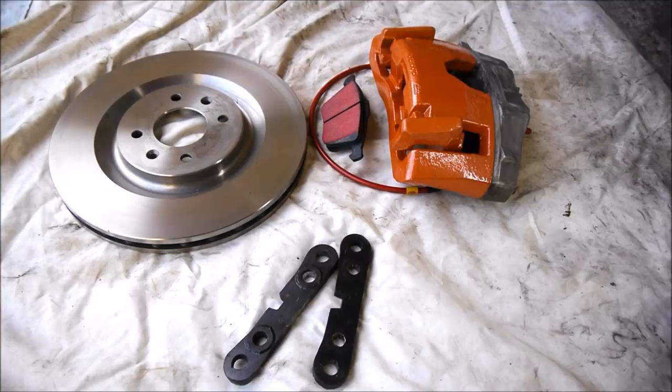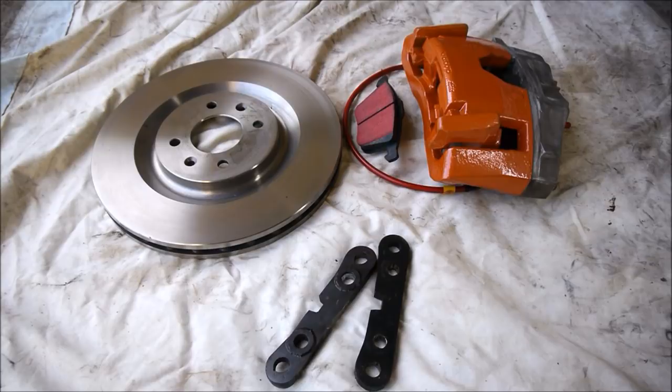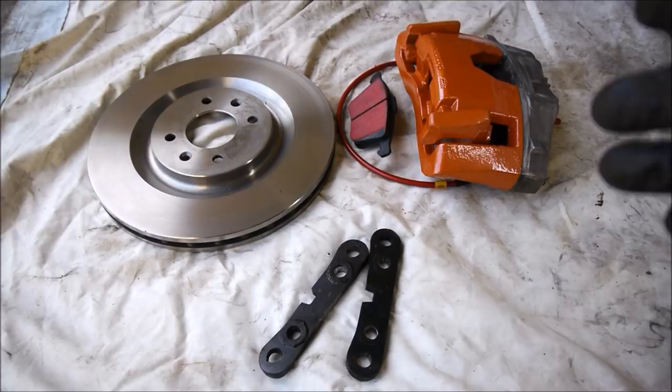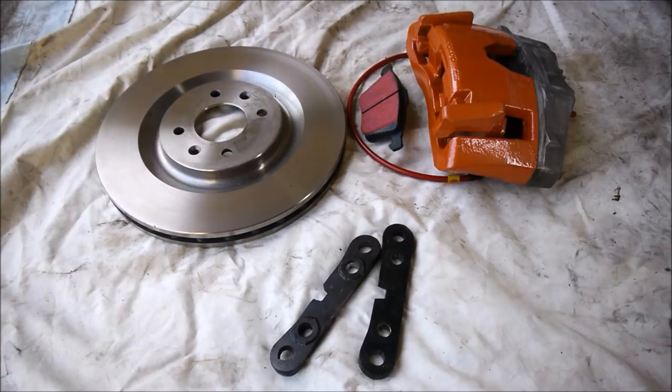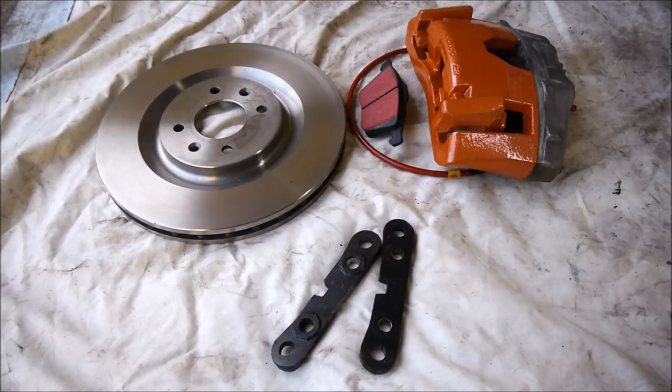If you're wondering why I didn't just go with the 300mm upgrade — which I also have on my channel; I did my 206 ones on my wife's 206 — that is also quite cheap and readily available. However, the pads are quite expensive, especially the performance pads. With these XC90/ATE calipers, because they're used on Focus STs, Golfs, Volvos and the like, the performance pads are actually quite cheap. Parts for these calipers are readily available too, so really the key cost is just these adapters. Once I've done that I'm really flexible with the calipers and pads.